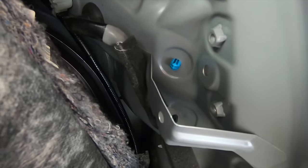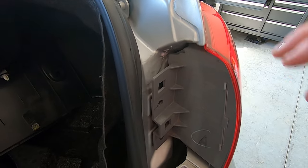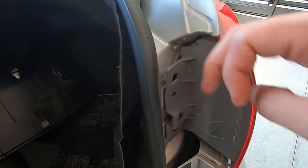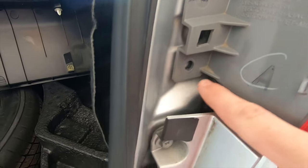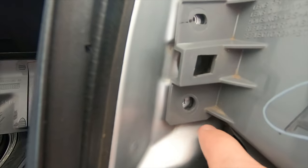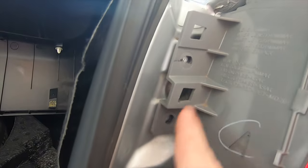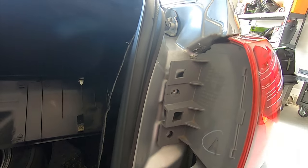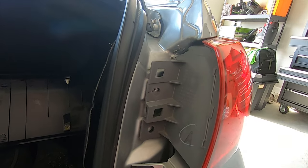To free the tension and get the tail light out, this little blue clip has to be compressed so it can push through the body of the car. With that blue clip pushed through, you now have space between the body and the mounting bracket to slip your finger through, which is more than enough room to run the wiring. We're going to run the wire up from the back side of the bumper, through that little hole, then pull it through and wrap it around the side of the lower bracket so there's no wire hanging on the outside of the frame bracket. I'll time-lapse getting this cord through.